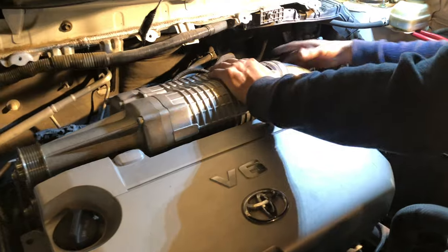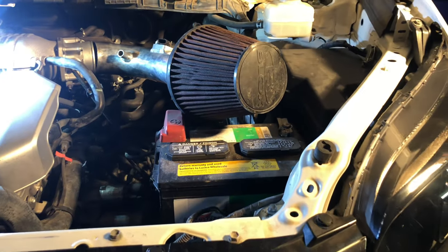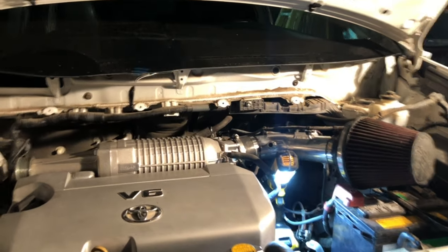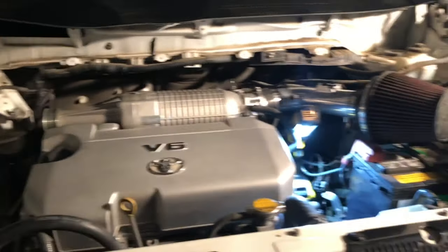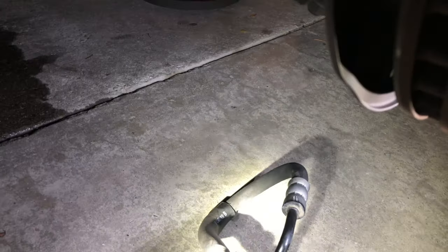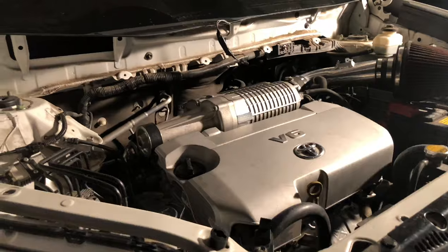It's been mostly time-consuming, not really hard. We had to use a camera to see if the bolts were tightening because of how tight the spot is - slowly but surely we're getting there. The blower is fully tightened now and we're just test fitting the intake - it has clearance. The belt isn't on yet because we need the power steering pump so the belt can wrap properly. This pump's hose is just looped to itself since we're not using it for steering - it's purely for belt tension.